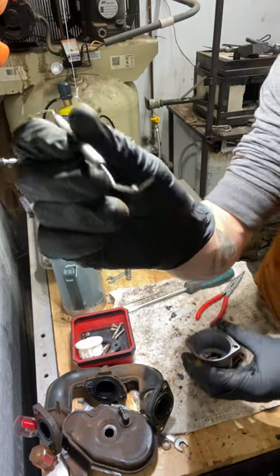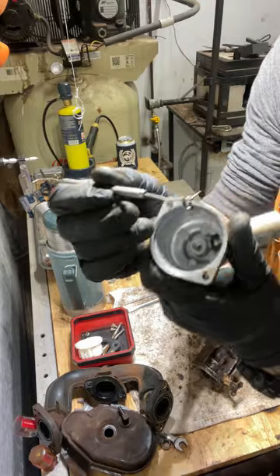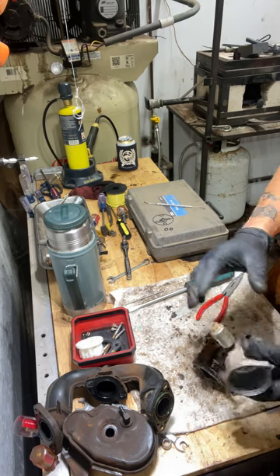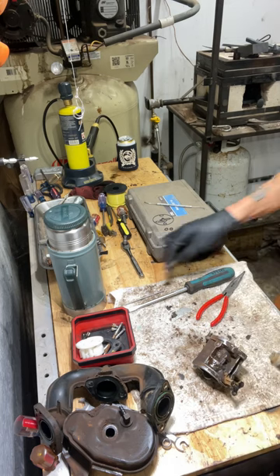There's an O-ring down there that I'm going to pull out because it doesn't look too happy — it's all flat. It's not really an O-ring anymore, so we'll be replacing those. I'll take this off — it's usually a 12-millimeter. That's the anti-backfire solenoid. All of this is going to go in the ultrasonic cleaner, and I'm going to clean the big chunks off of it right now.